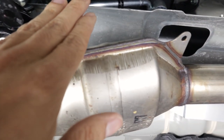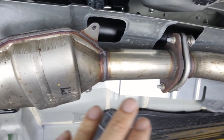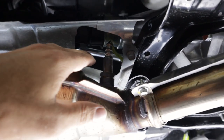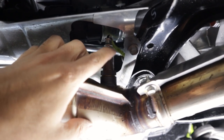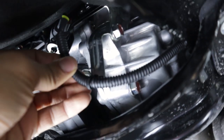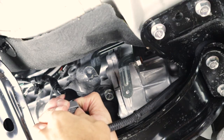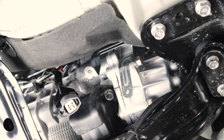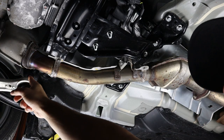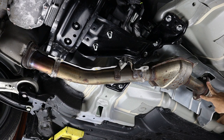Here you can clearly see the shifter from under the car. It's just above the heat shield, and the heat shield is above the mid pipe — as you can imagine, we have to remove both of them. The mid pipe does have an oxygen sensor that has to be unplugged first. The plug and the cable are attached to the transmission on the left side, so get needle nose pliers and pinch both of those clips from behind and you'll be able to detach the connector, unplug it, and remove them from the transmission. The center exhaust pipe rear — otherwise known as the mid pipe — is held in place by two nuts in the front, this bolt attaching it to this bracket, and then two bolts in the rear.